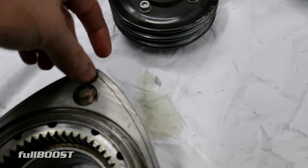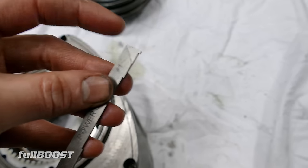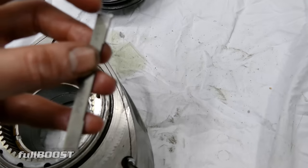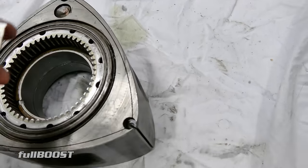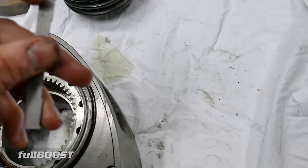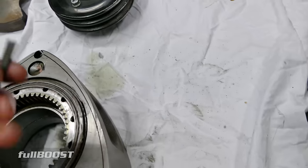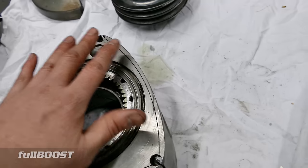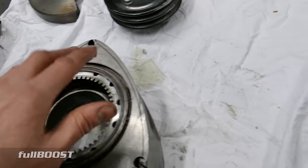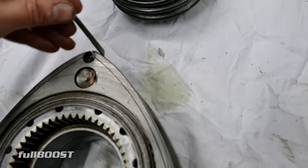I can tell you right now it's easy. Also you can see here it looks like it's two parts — that's because it is. When the engine basically turns over, this part will snap off from here. What I'm going to do is install it this way — I want the little piece that snaps off facing up. We're going to install it just in case it does break off, because if it breaks off and it's down on the front plate, it's going to be very hard to recover that without lifting out the whole rotor.